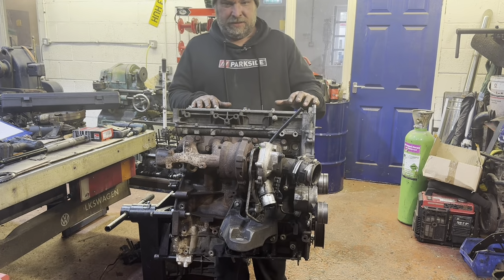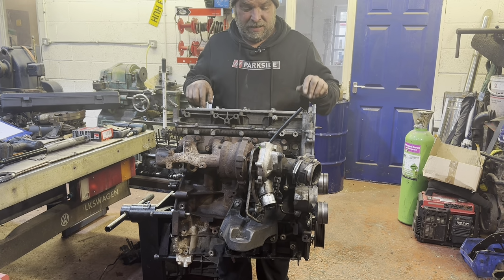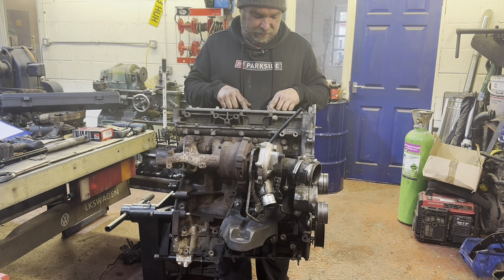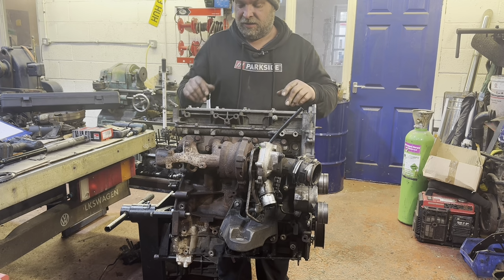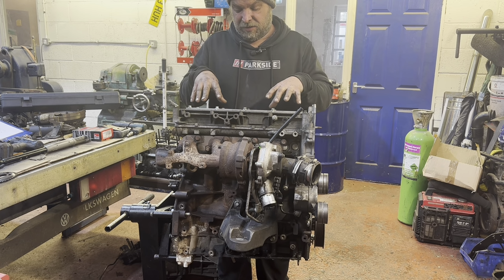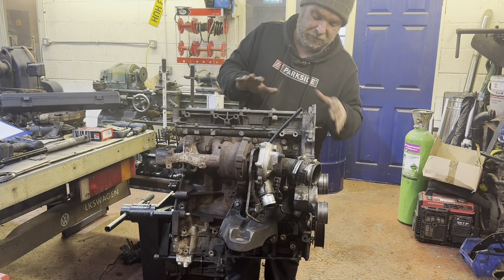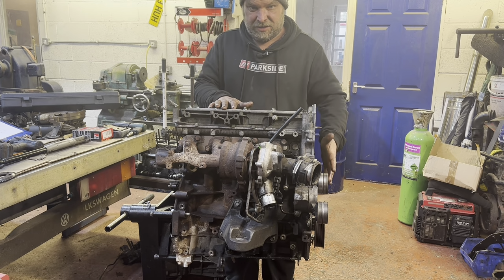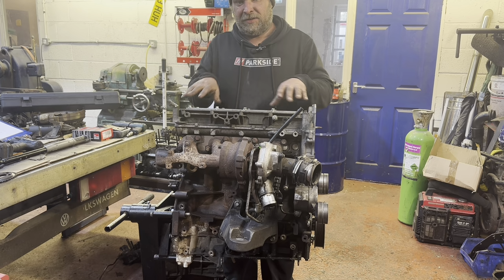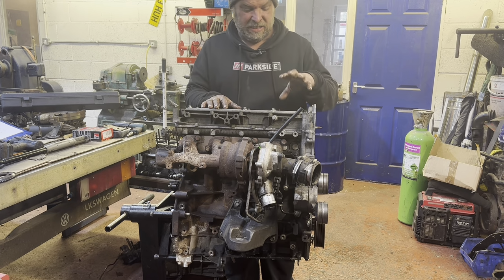To a point, we've seen the cam carrier gone in. Obviously, the top section of the cam carrier, whatever you want to call it, is siliconed down either side. I've used some grey Mercedes sealant, that'll do a good enough job. Then we've got the rockers dropped in the middle. Now, when you do this, you do need to make sure that when you crank this down, if you haven't timed it up, you don't have pistons at top dead center, just in case you've got valves out on something and you screw this in, it'll make a mess. So I just wound him gingerly off TDC.